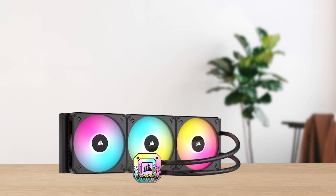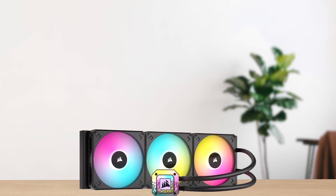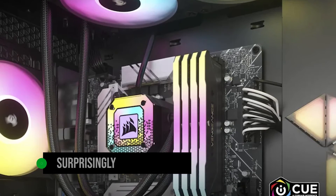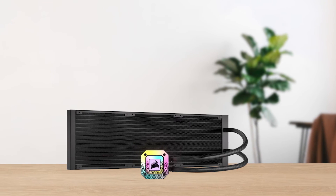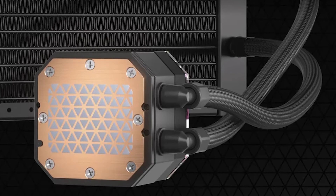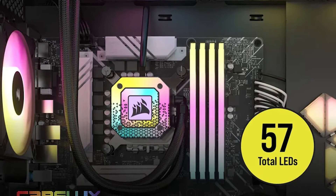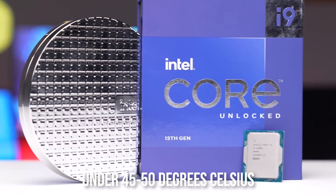It's a risky idea, but one that pays off well. In common workloads where temperatures aren't that high, the pump won't be working too hard, and fans won't ramp up or ramp down suddenly. The overall result is a surprisingly quiet 420mm cooler. Of course, you'll still have trouble fitting a 420mm radiator into most cases, which is a downside. Despite the quiet operation, this thing offers phenomenal performance — it easily beats out a lot of 360mm CPU coolers out there, leaves a lot of headroom for overclocking, and is capable of keeping the i9-13900K under 45 to 50 degrees Celsius even with intensive workloads.